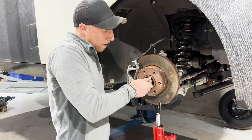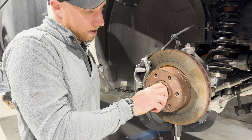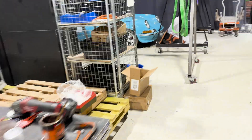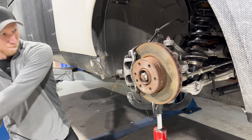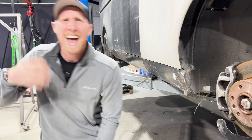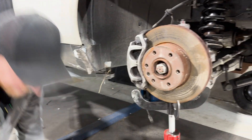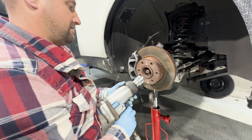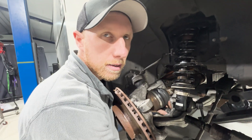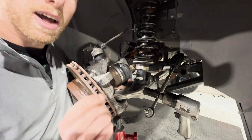Is this sacrificial at this point? You put the nut back on because if you damage the threads, you can wind the nut back off. We need a copper mallet — go search the toolbox, see if by any luck it might be in there. We're going to remove the bottom of the shock. Everything's coming off — it's like one of those things where you go 'I'm sure I can do it without taking the subframe out,' and you get four hours in and guess what? You have to take the subframe out.